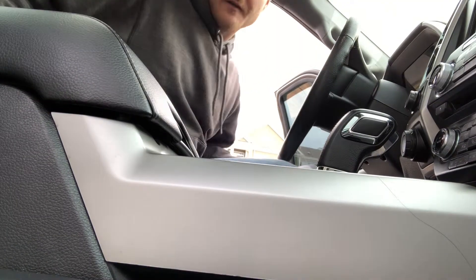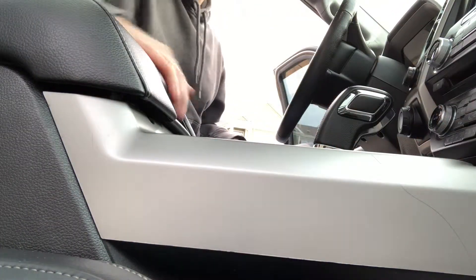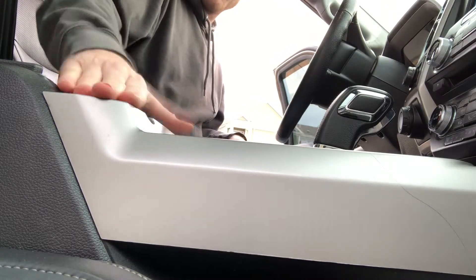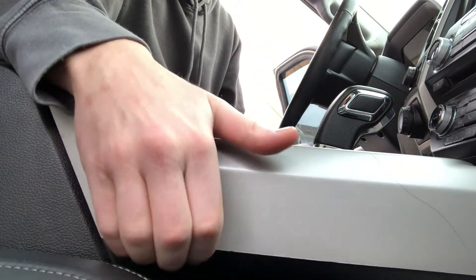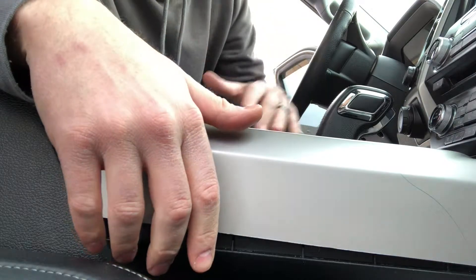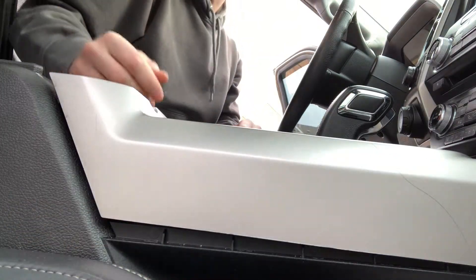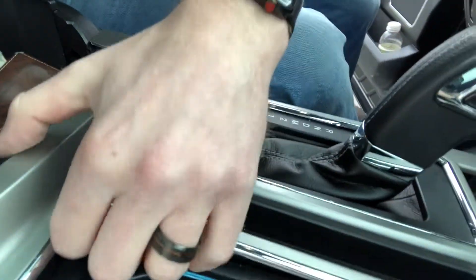It's going to come out just below the lip of the tray where that holds your organizer. So the first thing I wanted to show you was how to get this piece of plastic up. You're going to open the center console — there's a lip here that'll be stopped from opening if the center console is closed. You're going to feel this lip, grab it out a little bit and pry it straight up. There are just little clips under there, like on the door sill, and that's off — they just pop in and out, little metal clips.